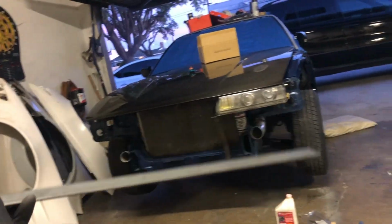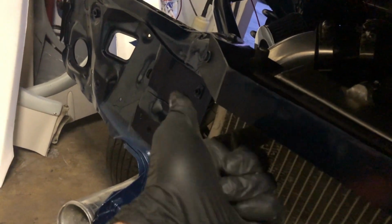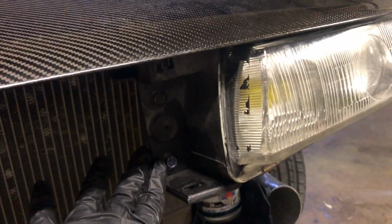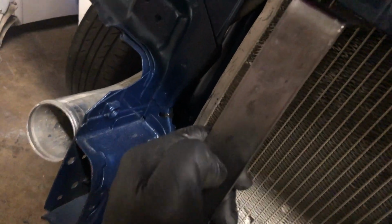So essentially, you start off with this flat piece of steel. This one specifically is an 1/8 inch steel. So my thought process is you bolt it up behind here. It's going to come on here and a 90 out to get the distance that we need, come flat down to bolt onto the headlight bracket, and then diagonal down and bolt right into the factory location where the original one does. So we start off with this. We bent this in the vise in the back with a hammer. We put it into here, line it up with that, figure out where the headlight's gonna be, bend that 45 angle, and then meet it up into there.